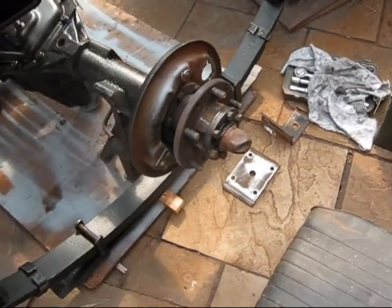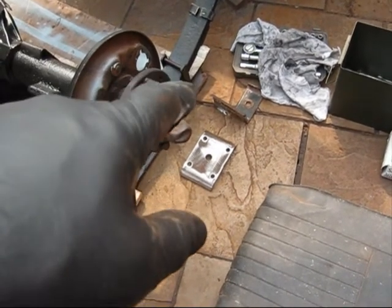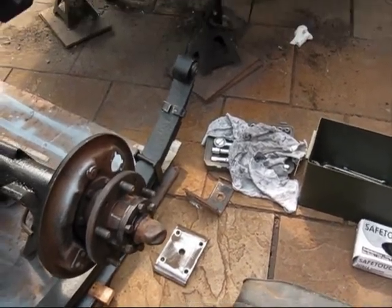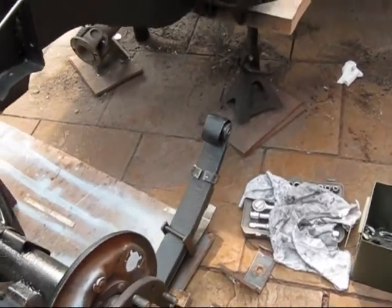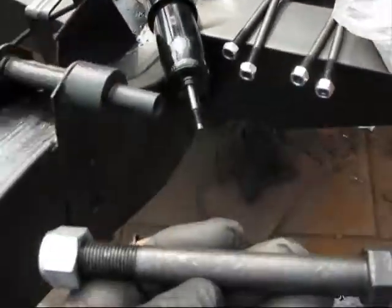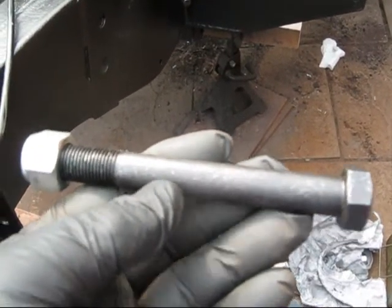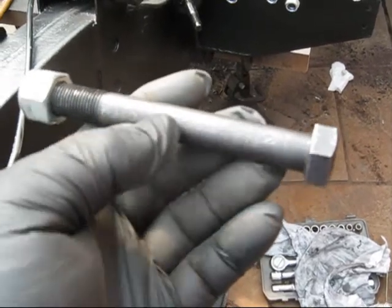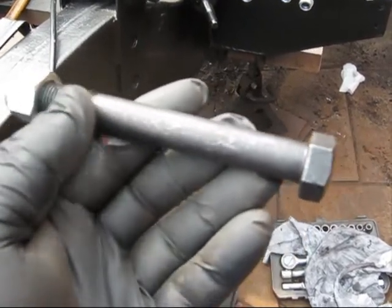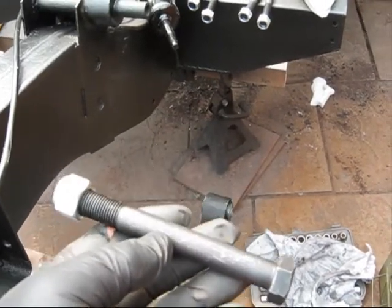Got a few bits and pieces around. I haven't painted the bottom U-bolt clamp or the other bits and pieces, but I'll flash over with a bit of black at the end. I'll start with the first bolt. This one is evidently the front shackle — sorry, the front pin — slightly longer. This section here usually goes all the way through so it actually sits and rides on that, not on the threads. On the back section with the shackles, they'll be threaded into the shackle pin itself.